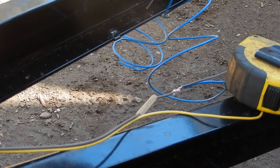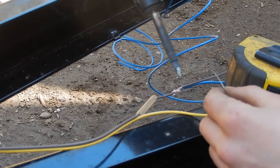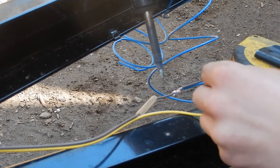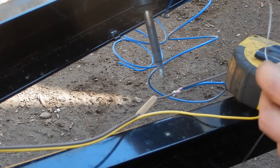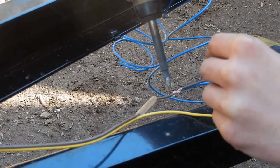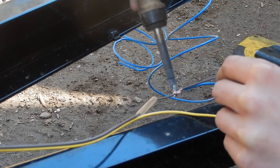when you put your soldering iron on the joint, melt a little blob of solder right onto the tip of the iron, and then touch the iron to the connection with that blob of solder. That will give the soldering iron tip more surface area touching the joint, and it'll transfer more heat. It'll heat up the joint a lot faster. Without that heat bridge, it's called, you're never going to heat your joint up. And then once the heat has flowed into the joint, you feed your solder into the joint, not onto the iron. And you'll notice it just sucks the solder right up. So I'll do that. I'll touch some to the tip.